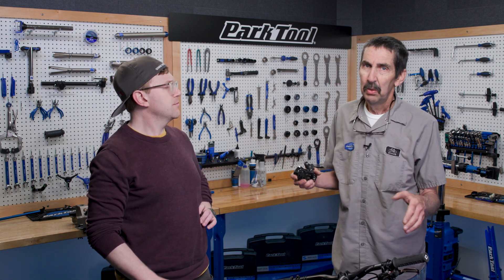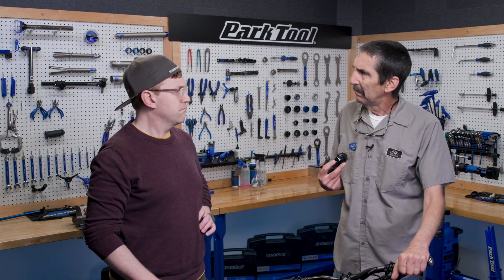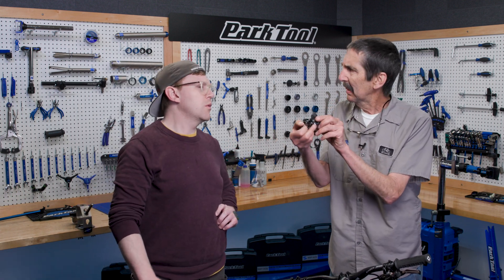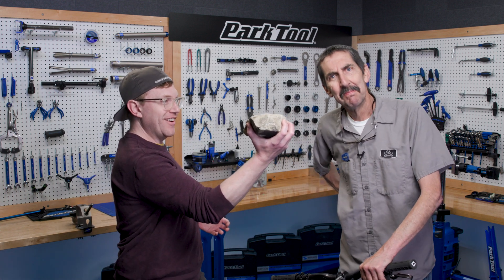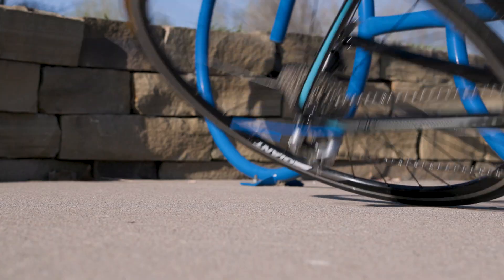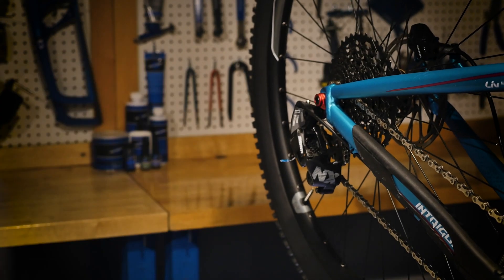The question is: what kind of stress can there be on the rear hanger when we ride? Almost none. But we know hangers get bent — what is it that can bend rear hangers? Impact! Crashing, smashing, things hitting you, you hitting things — those are the types of things that can bend a rear hanger. Not the plain old stress of riding.